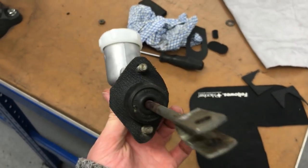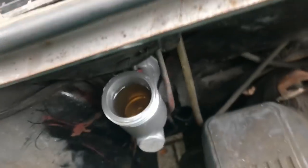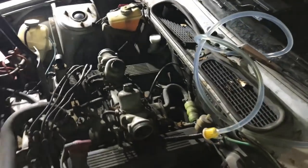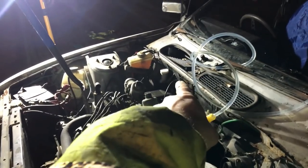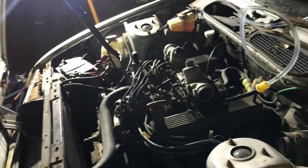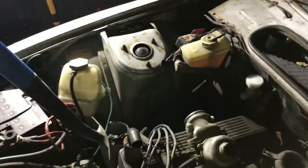Before this goes back in I've made myself a little rubber gasket using my colleague Emma's mouse mat. I've got the reservoir on and I'm topping it up with a bit of fluid - I'll have to bleed it later properly. It's now night time. I've refitted the clutch master with the improvised mouse mat gasket, and set up my temporary fuel supply because I want to try and drive the car. I filled it with fluid and bled it as best I could by myself using gravity and pumping the pedal a few times, getting under the car, opening the bleed nipple, and repeating. I managed - I don't quite know how - to press the clutch pedal with the car in gear with my foot and rotate the propshaft by hand with one leg through the door and the rest of me under the car. It's a good thing I'm quite tall.